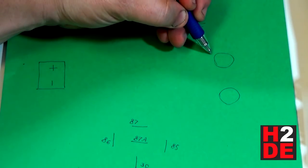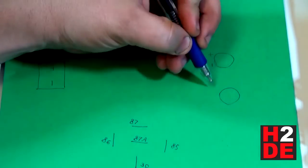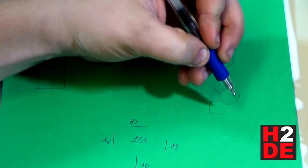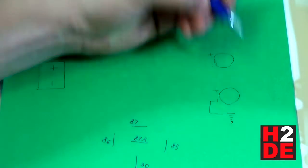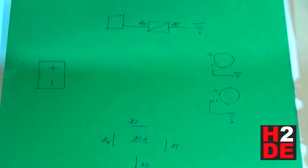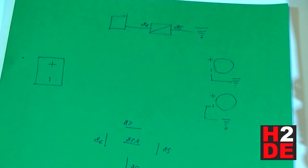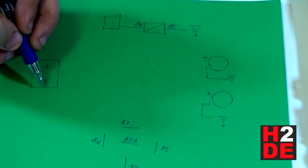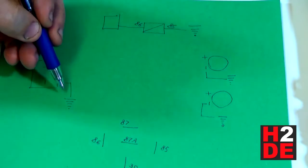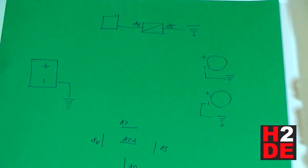For the auxiliary lights, you'll have a positive wire and a negative wire. Your negative wire will simply go to ground — bolt it to a chassis ground or some clean, prepped metal on your truck or car to make a good connection. Your battery is already connected to ground, so connecting the lights to a chassis ground completes the circuit back to the battery.